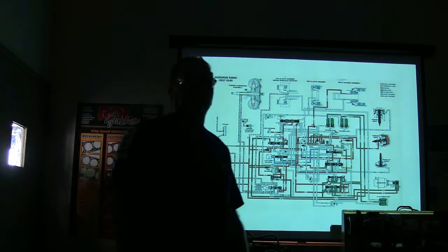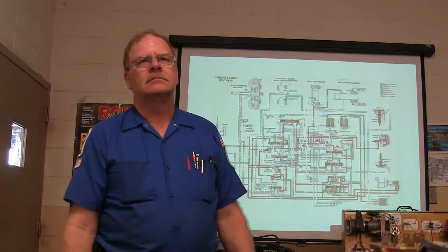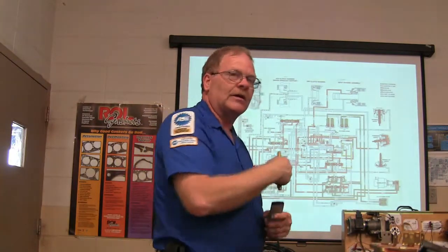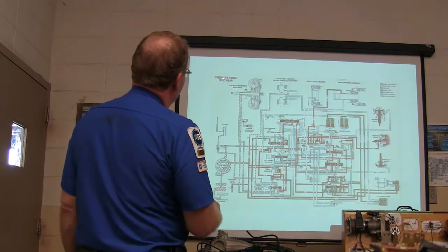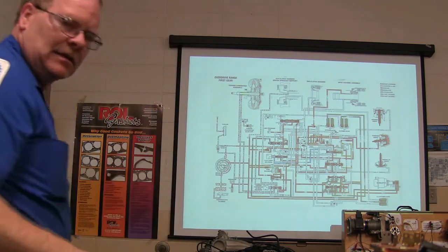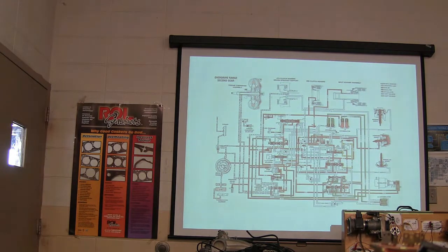What happens when a torque converter clutch solenoid energizes? It puts it in its lockup. Lockup means the engine and the transmission output are locked together. That's not the way this is right now. You've got your overdrive gear range though, and you can look at this. Now what happens when I change to the next gear?